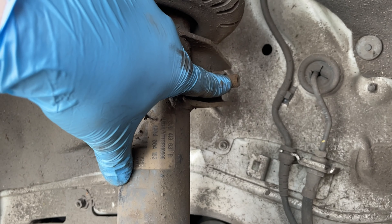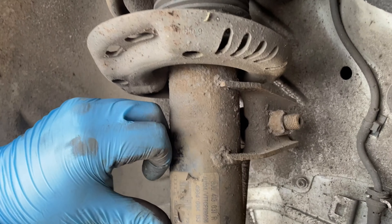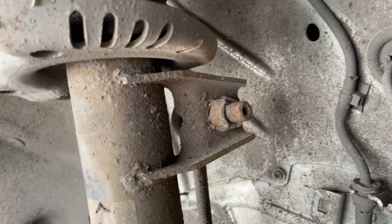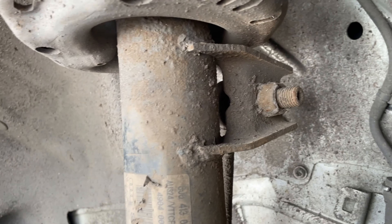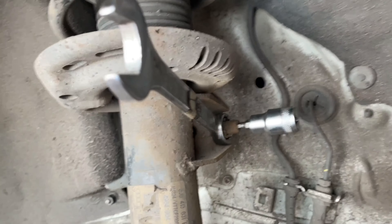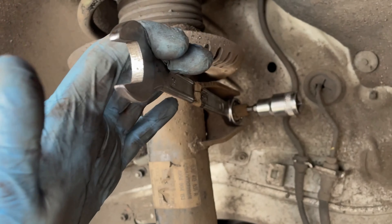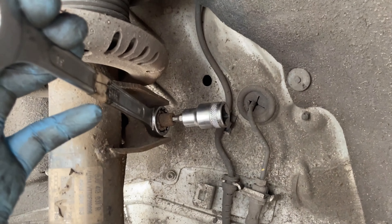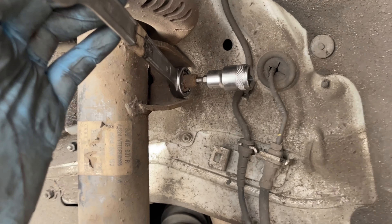That thread will want to spin when you get that nut free. In there is an Allen key hex, so if you get an Allen key in there and a ring spanner you can get it loose — pull down on your spanner and keep tension on the hex the opposite way; that's a five mil. I'd recommend drowning it in WD-40 first because that was an absolute pain to get out.